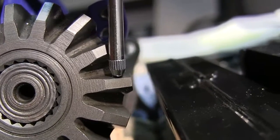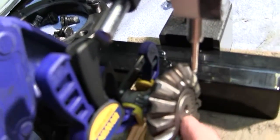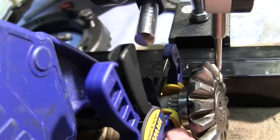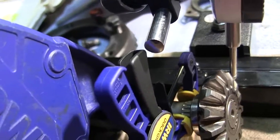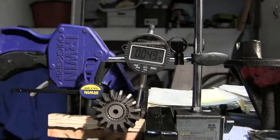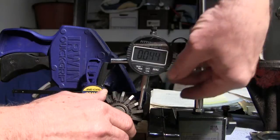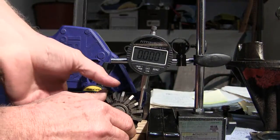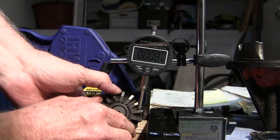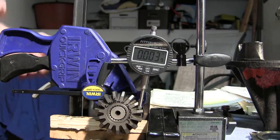That's where I have it set on the tooth, flush with the front — it would probably be riding there. To keep it from moving backwards I've got a clamp here so I don't get angular action, because this is at an angle. This is the left sun wheel. I'll twist it down and zero it, now I'll raise it up. I got .0085 — I just call it slop in the splines — on the left sun wheel.